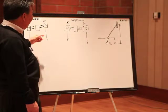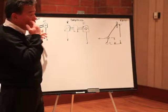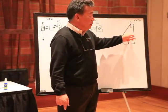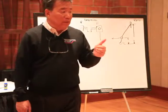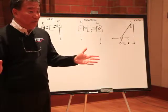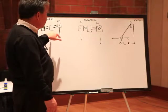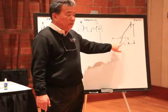If you think about it — let's say that the front push rod is 6 millimeters longer than the rear push rod. With a 5 to 1 pedal ratio, that means that the pedal will get harder quicker by 30 millimeters. That's no small gain. So when you watch this, a little change on the balance bar makes a huge change in the brake pedal feel.